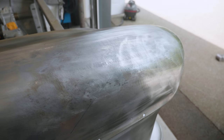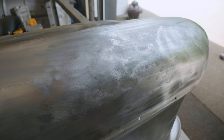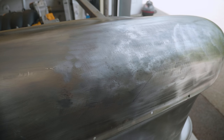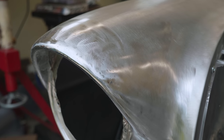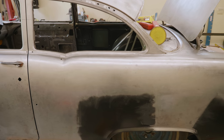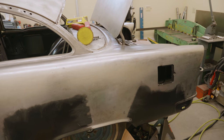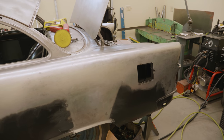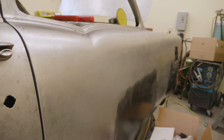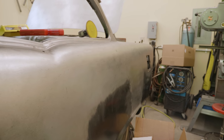Here's a quick example. This front fender on this 55 Bel Air I've been working on — I knocked a few dents out of it, repaired a few little sections here and there. I have not gotten around to fully finishing this off. You can see there's a little bit of grinding, a little bit of file marks on this fender — they're just not the prettiest things in the world. It's not the finished look I want to present to the customer. Now this quarter panel, however — I replaced a huge section of it and sanded this down to about 120 grit with a DA. That just has a really nice, clean, uniform look. It's going to give a good surface for the body man to work with and present a really good finished product to whoever lays their eyes on it.